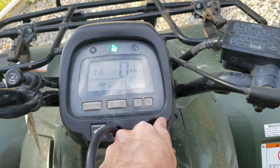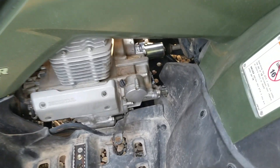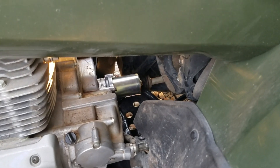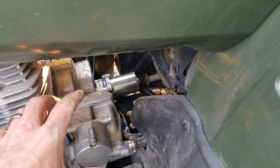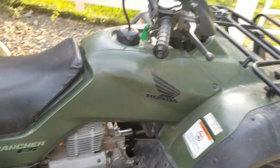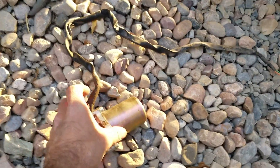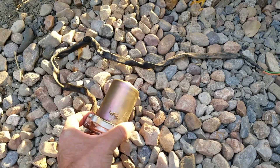That's a quick easy way to fix the five-blink error code for the electronic shift. Just a reminder — I'm not a professional, so be cautious, wear the right PPE. One tip when putting in the electric shift motor: you might have to wiggle and rotate it a little bit as you're installing it, and don't over-tighten the bolts. Hopefully this video was helpful. This part cost me just under $200 — I'll put the part description for this 2005 Rancher in the video description.